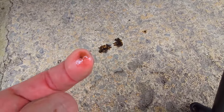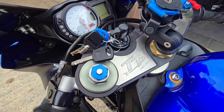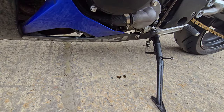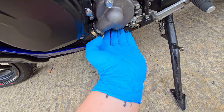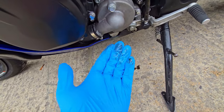I want to get this fixed ASAP because I don't want the risk of oil going onto my rear tyre when riding, and I don't want the oil leak to get any worse. After doing some research online it turns out the older GSX-Rs suffer from a common water pump issue which can cause oil and coolant leaking from a small weep hole located in the centre of the water pump. What normally happens is the seals inside the water pump begin to fail over time. I put a blue glove on and checked the bottom of the water pump, and I can clearly see the oil is coming from the middle of that area, which confirms I have that common issue.